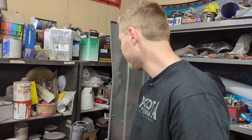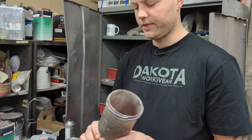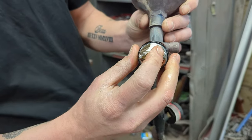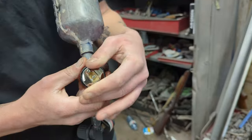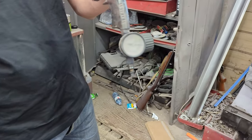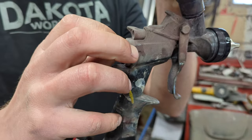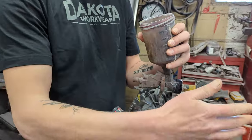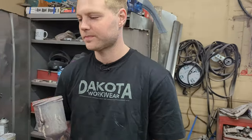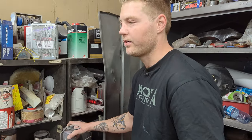For the gun, tip size and pressure all matter. The gun I've been using was $160 at Princess Auto — not a fancy gun. You want to get a gun with a 1.3 tip. Get a regulator on the gun — not on the compressor — with a water separator, and regulate it at 35 PSI. Then I turn the flow way down until I get the desired flow. You want a fine mist coming out, atomized properly — you don't want blotchy spray. If it's going on too light, turn the flow up; if it's going on spattery and too heavy, turn the flow down.